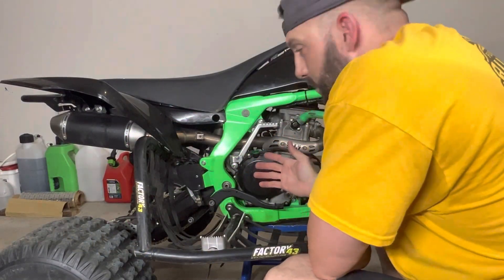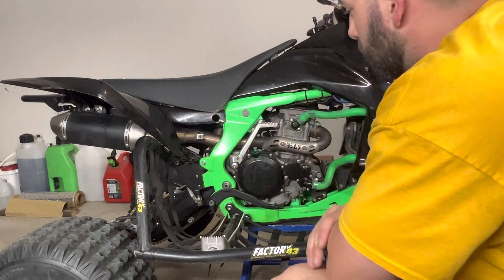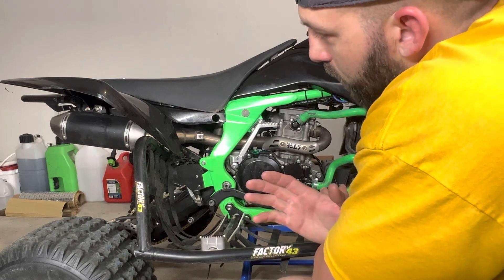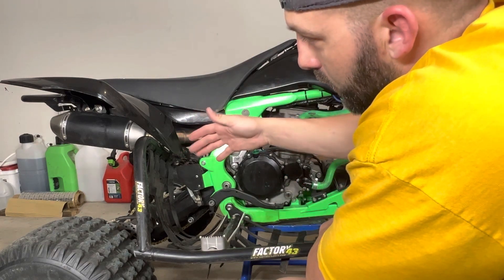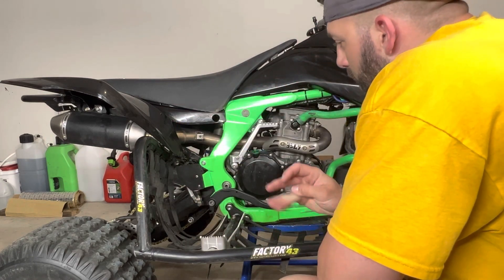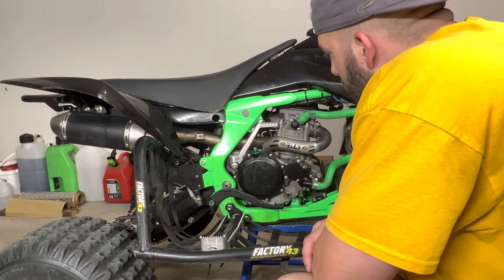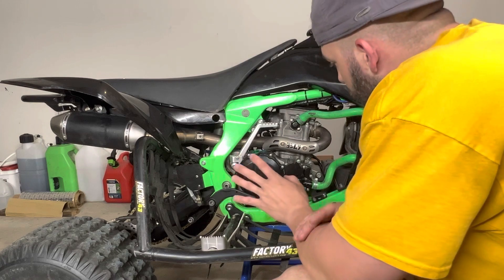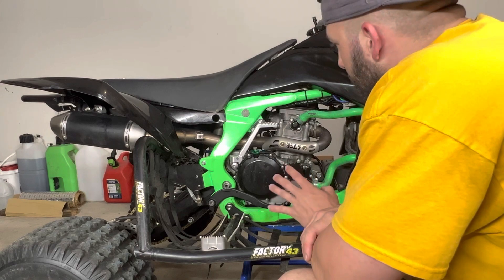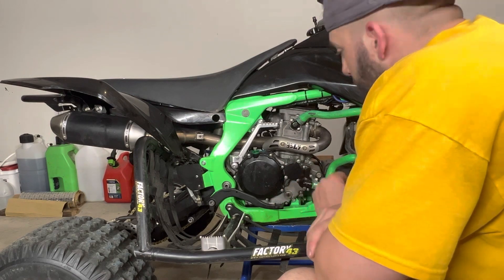You've got the kicker, an LS4 rear master brake protector. It's got Yoshimura full exhaust — I'm a big fan of shorties so I ended up cutting the exhaust, repacking it, and making it into a shorty. The swingarm is powder-coated in that texture black. I fully went through the whole motor — it's got 20 minutes on it, all new gaskets, a couple new o-rings where needed. Runs like a freaking top.